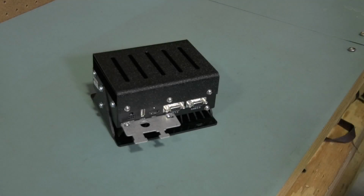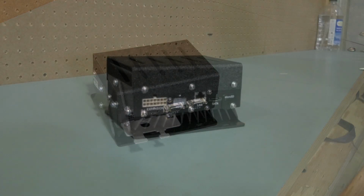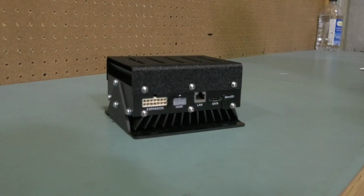If the SD card is down or removed, the unit will not record. It is imperative that the SD card is up and recording data. In the event that an SD card must be checked or removed, please observe the following process. Before beginning this process, ensure the ignition is off and the unit is powered down.